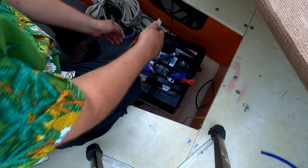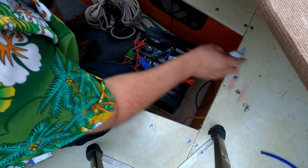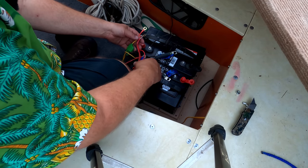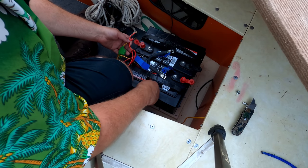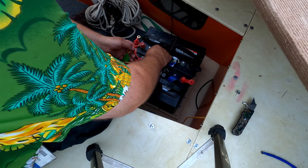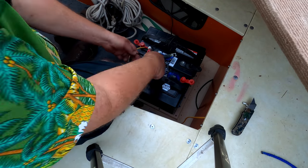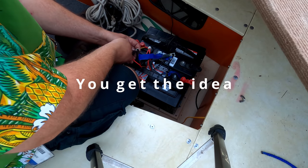And I only work on one at a time. So I'll go ahead and cut this one off, which was all left battery positive. And that way I'll run these wires underneath the straps like this. And over here, same way. I'll take these three and run them so they're neat and organized and not just complete chaos, and this doesn't come out like a complete tangled mess. We'll put a little nut on it temporarily to hold it. And then we got right battery negative. Then I'll cut that one.